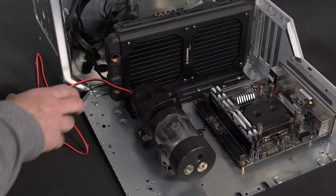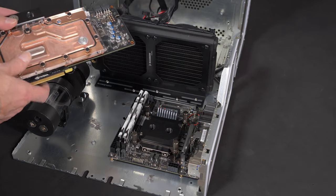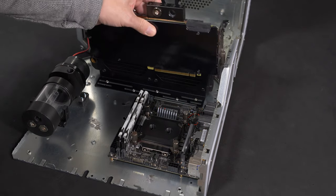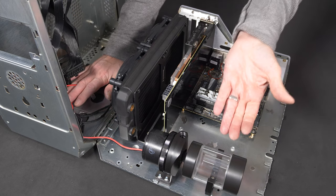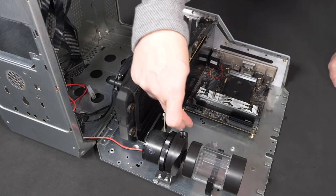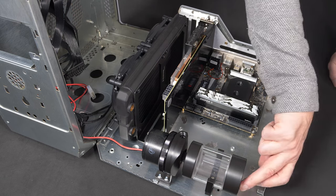At the moment it's got far too much cable which needs to be shortened because it could reach pretty much around the entire case. Now we can slip our graphics card in place — it's a relatively elderly GTX 980 with an EK block and back plate, but it looks the part and should do a decent job in this build. I've gone for everything mounted on the door, so the flow path is: pump-res out into the rad, out of the rad into the graphics card, out of the graphics card into the CPU block, out of the block, back into the res. In principle that should work.